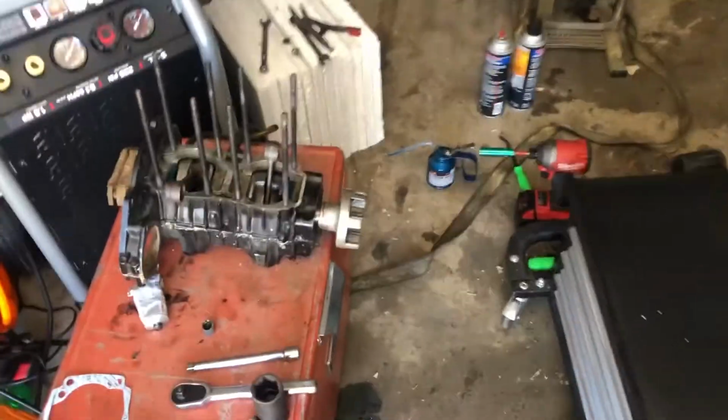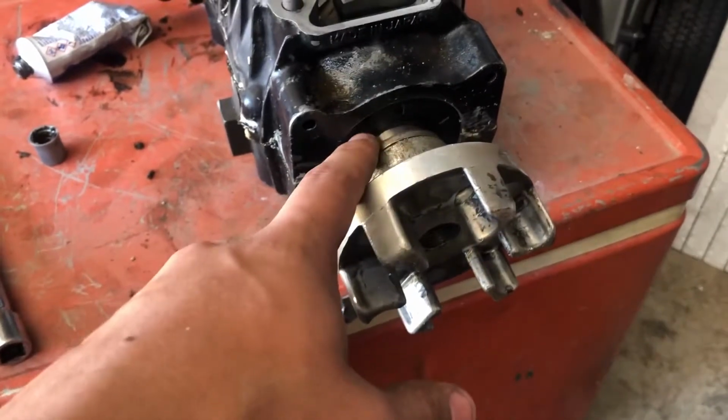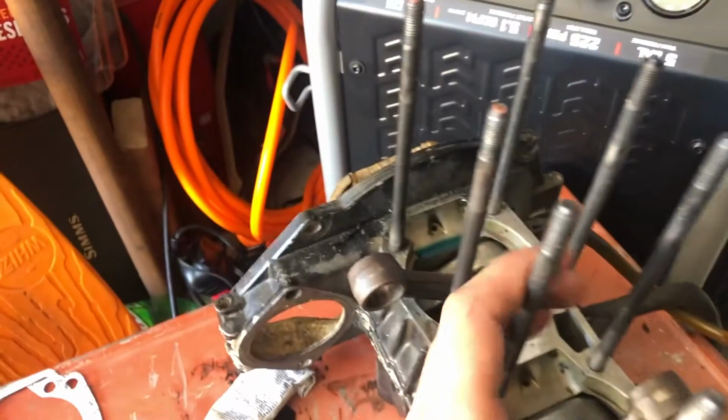Alrighty, so lots and lots of time lapse. So we eventually got the coupler off, and we need to do that to replace the seals. They're all in there. They were disgusting and absolutely shot. That's what led to our flywheel failure, and just not working properly.